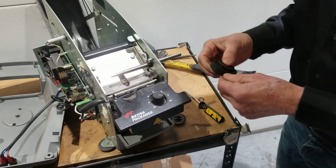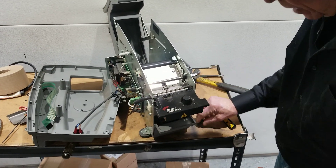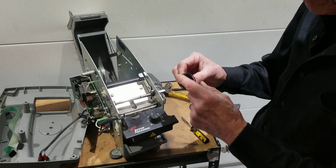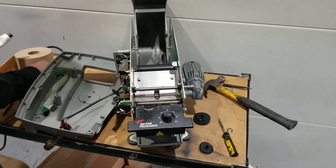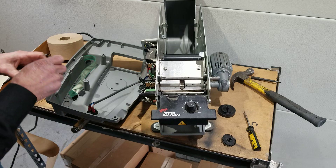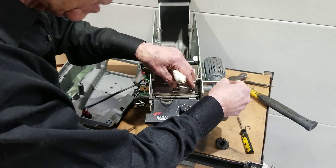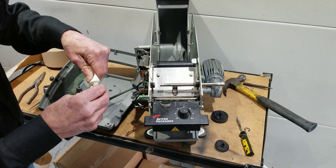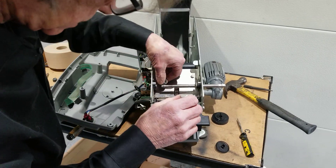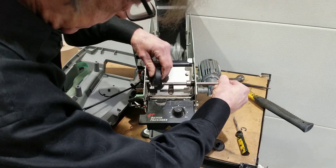When we put the new feed wheel on, one of the things we like to do — the upper feed wheel shaft is held into position by just this little small clip right here on the encoder disc. And if that clip weakens, the shaft can start moving. So what we do when we have to replace an upper feed wheel in our shop is we like to put a collar on this side. We take a little lithium grease and slide it over. We put the washer on first, then we take one of these locking collars that are stainless steel, put a little lithium grease on this collar because it's going to rub against the metal. We put that on next, then we take our new upper feed wheel and slide that on next.